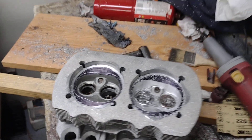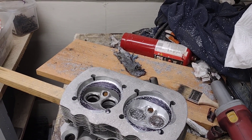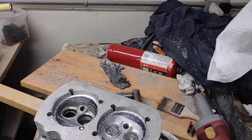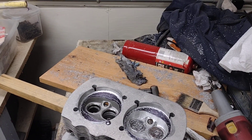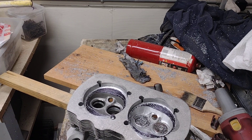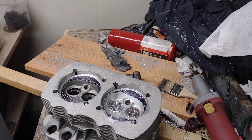The reason we're doing this is this gentleman's motor is basically a stock motor, just going to be larger displacement. It has a stock camshaft, stock rocker arm, stock carburetor on it — everything's stock except for displacement. These heads have 52cc chambers as cast, which would probably be okay with a stock engine, but with the 92 thick-wall cylinders on it, that puts the compression way too high. He doesn't ever want to change from the stock carburetor; he wants basically a stock motor. This is the route we're going because that's the parts he already had, which led us to building another thick-wall 1835.